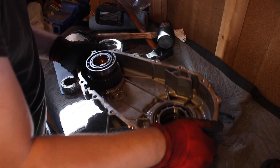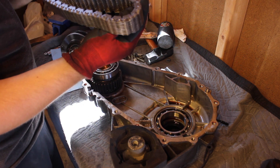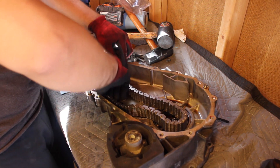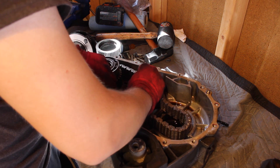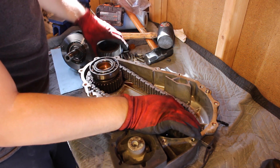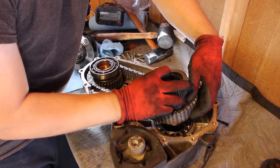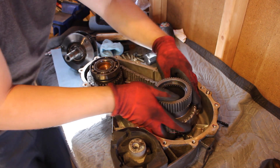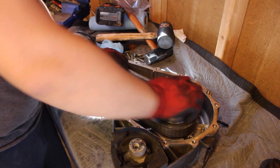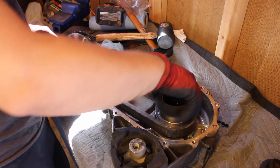Let's put the transfer case back here. Now we want to wind the chain around here — the blue link should face up. Stick it in here and make sure it seats. It's a little tricky, but it'll seat eventually. Once it's seated, pull it taut as much as we can, put the chain around it, and then kind of wedge it in there. There we go — hear that slam? That's a good slam. Yeah, it's a lot tighter now. Not nearly as much play.